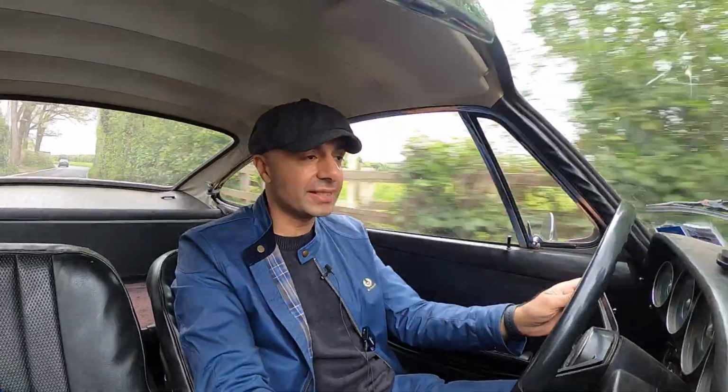of the distributor, the sliding surface that I'd torn, and I put it back together without that. And at first it seemed like it was working, but when it got really hot, the idle speed was high again, and I think that's just because the metal expanded, there wasn't enough grease, and the vacuum advance got stuck again. So what I did was I changed that. I bought from Sierra Madre Collection. I bought the sliding surface.